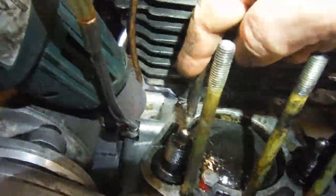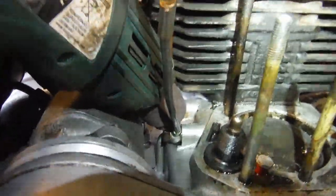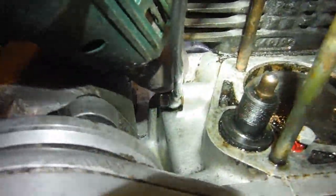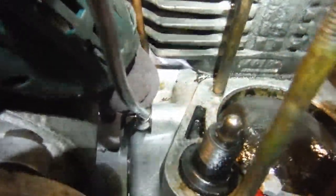What I've been doing is, with the crankcase area down there nice and warm, I've been pumping oil under pressure from the oil can. Bear in mind that that's not a very high pressure side of the system because it's the rocker oil feed, so there isn't any great resistance and there wouldn't be any great pressure either. I'm sure that the oil can can probably replicate a lot of — maybe most of, or all of — the pressure that that side of things would normally be under.